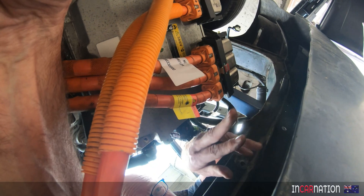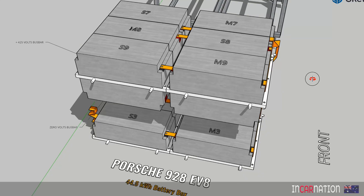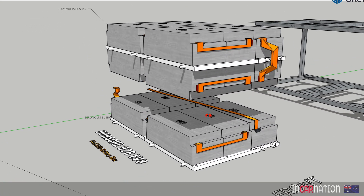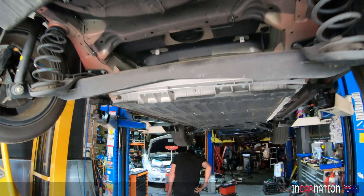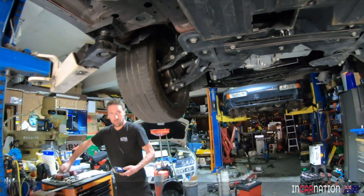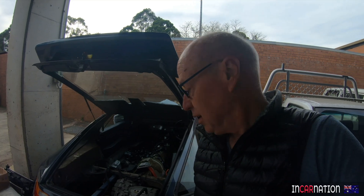A few committee members are still at home: the onboard charger is not connected, the BMS is still in the battery pack, the SDM crash module is a real party pooper that can't get over the fact the car was once crashed — and we know we don't need him anyway. The other modules, I'm pretty sure we don't need to get the wheels turning: power steering, the telematics box that tells MG back in Shanghai what nonsense we're up to. The rest is looking okay, so we're getting close to reattaching the high voltage battery and the BMS.